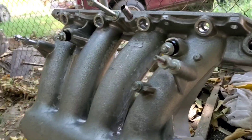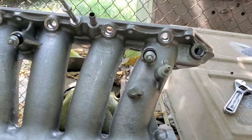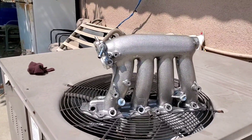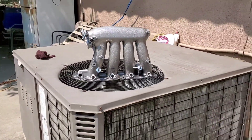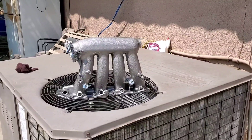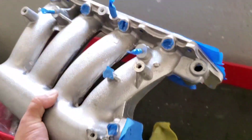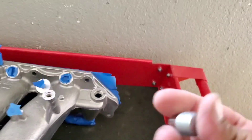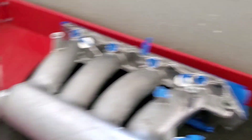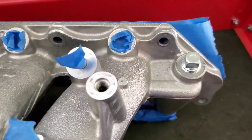Now what we're going to do is just clean this up and then spray paint it - cover the injectors, the intake, the runners, then we'll spray it. There she is, nice and clean. We'll just let her bask in the sun for a bit, get nice and dried up, then we'll shoot some black paint on her. I have everything all taped up and sealed, except for this sensor hole - I'm not putting that sensor back in, I'm going to put this plug and put some Honda bond on it and plug it up.